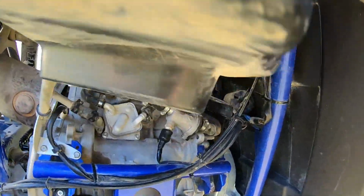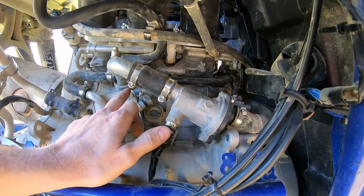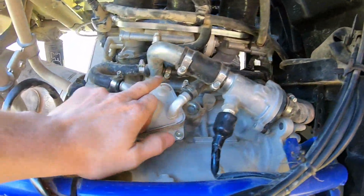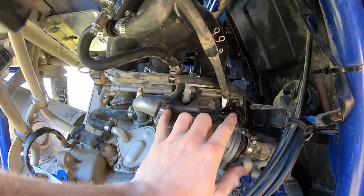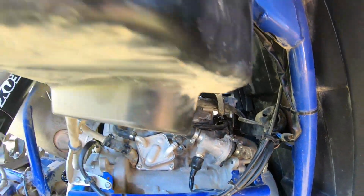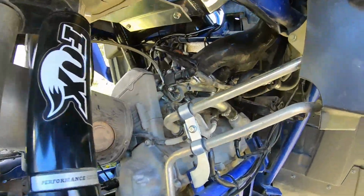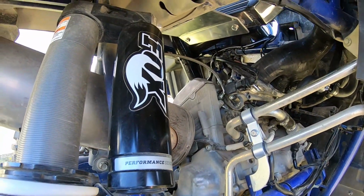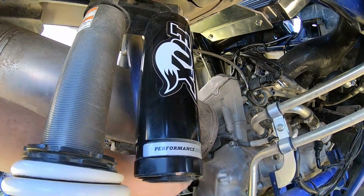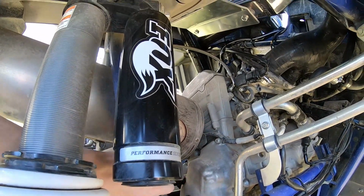The coolant feed and return line, they also left out kind of vague in the instructions. So there is a small little 1/4" line that goes from here and it goes to here. So you're going to remove that line, and that's your supply and return for your coolant system. They say that the oil return to your crankcase is on the passenger side of the engine, which it is not, which is maybe just a typo, but here it is. It's going to be the small one on your stator cover, not the big plug, the small one.